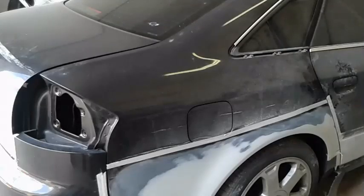And the second example is the rear wings and rear doors line. There I suggest you sand very carefully, and I usually don't go more than 3 millimeters. After you finish, do a quick check on the shapes and use your fingers to feel if the edges still have something to fix. They may have. So I suggest you double check, and not paint over a bad shape.